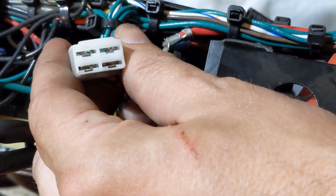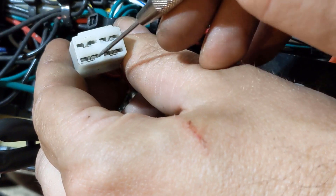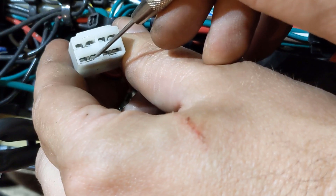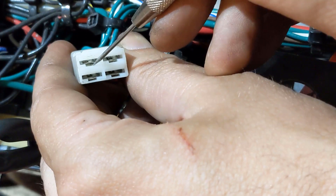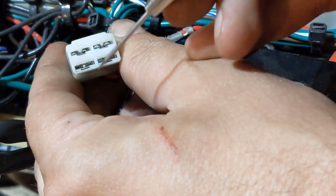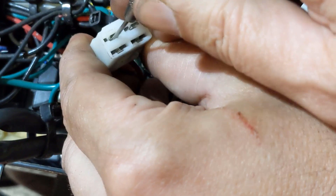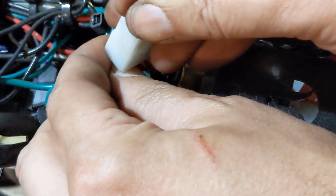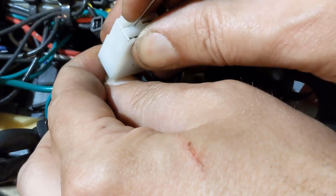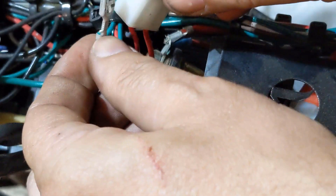If you're not familiar with this kind of connector, it's got a little lock pin on the underside. It looks a lot like a spade, but see this little notch right here — here, here, and here. You need something long and thin; flat helps a little bit. Get in under there, push it all the way in, give it a little leverage, and there we go — it comes out. You can see this little tab here is what was locking it in.